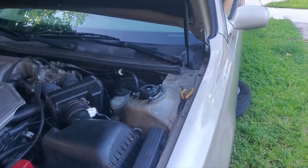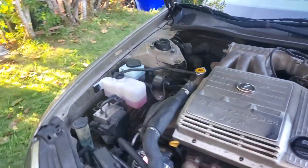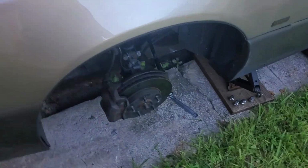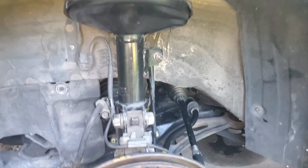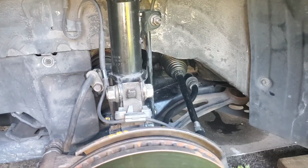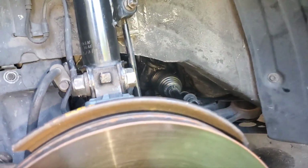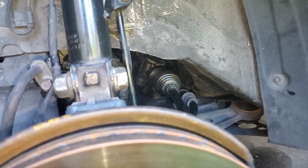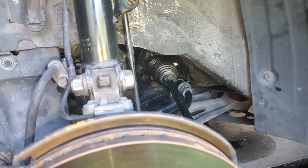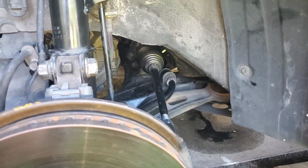but then I actually bled it in 3 stages. I bled it in the first stage when the steering rack wasn't attached to anything. It was not even the outer tie rods. Then I put it back together to like this assembly, and I turned it lock to lock, and that actually worked a bit different, and it actually pushed more air. I think there's something with the valve right in the steering rack where it needs a certain amount of tension to actually open that valve from each side. So if you just have the rack by itself, you're actually not getting fluid into the cavity.